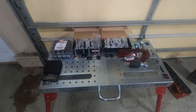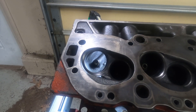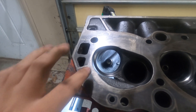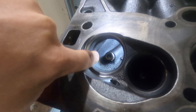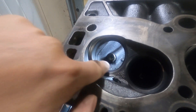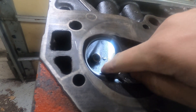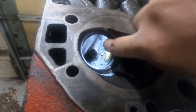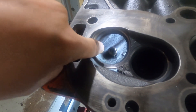With that out of the way, I'm going to go ahead and clean off the little workbench here, grab one of these heads, set it up, and start grinding. I set up my light in the back of the intake port so we can take a peek down the valve seat and see exactly what I want to work on. Over here on the left is pretty much the worst portion — there's definitely a bulge right here that really gets into the diameter of the seat itself. The seat's cut pretty decently down there and then it kind of hits the actual runner, and that's where there's these little lips.